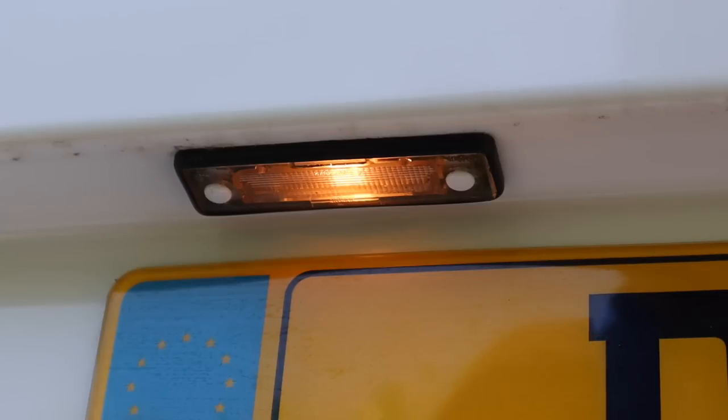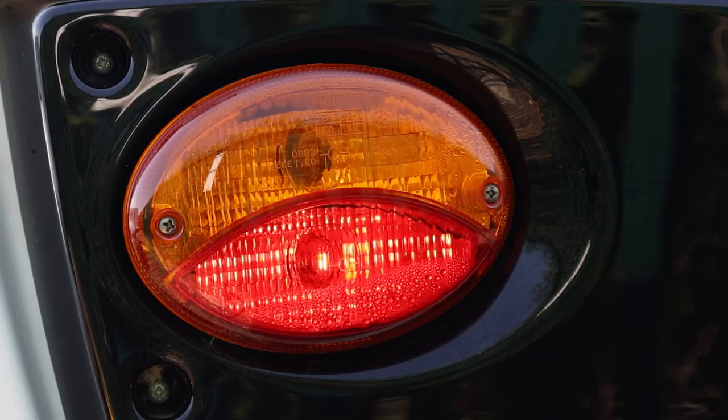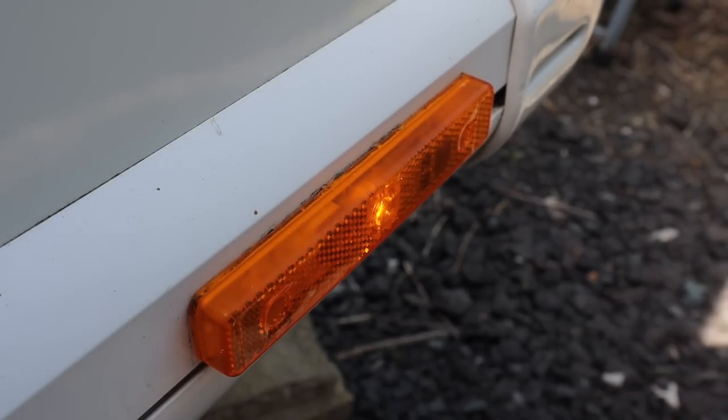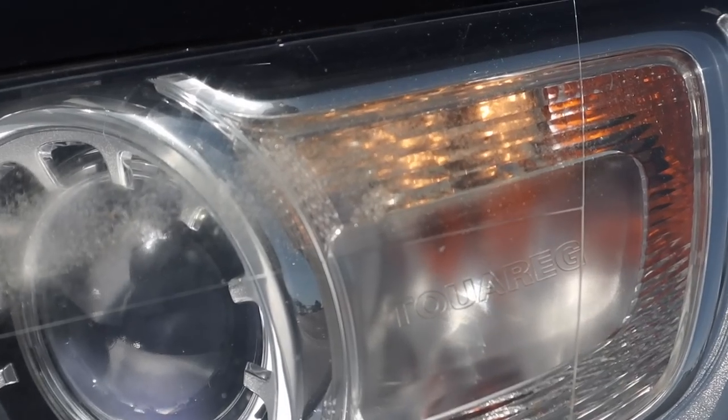The next important one is the side lights. Now it's difficult to show this today because it's so bright and lovely out here, but if you are traveling in the dark, at dusk, or in poor weather, this is a super important lights check to perform. Make sure that every side light is working. I start off with the number plate — I cup my hand under the number plate light to make sure it's illuminated in bright daylight. I make sure that the side lights are working at the rear of the caravan, then I make sure the running lights down the side are illuminated, finishing with the marker light at the top at the front and the marker lights at the bottom front as well. Also do a quick walk around the car to make sure the side lights are working at the rear of the vehicle and at the front.